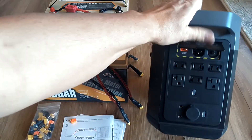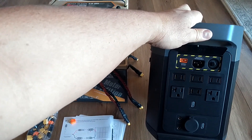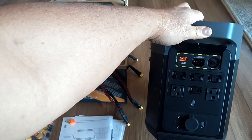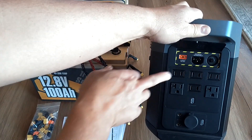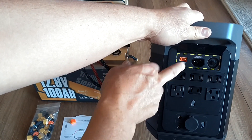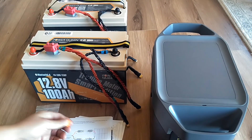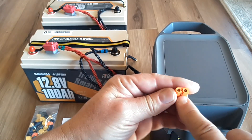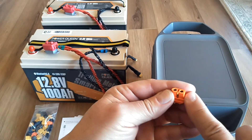We're going to talk about this connector. This is an XT60i connector on the input. If you connect a standard input like a car cigarette lighter, they have a limit of 8 amps on it. If you hook it up to solar at 60 volts, you can go up to 500 watts on this specific power station. The way they control this is through the center pin right here on the connector — if you connect the center pin to the positive side, it's going to limit you to 8 amps.